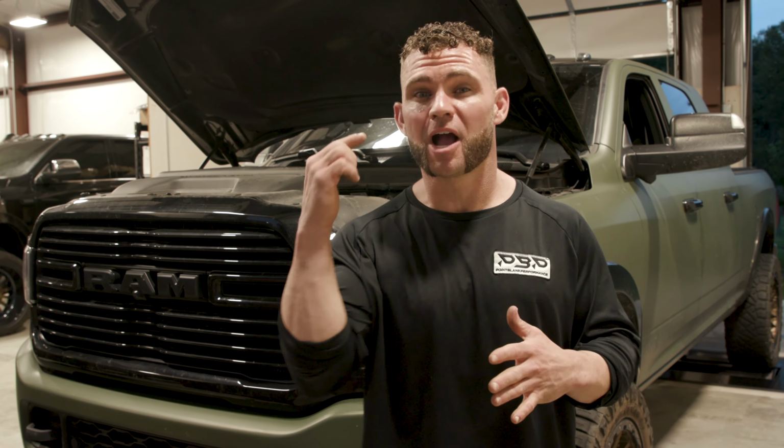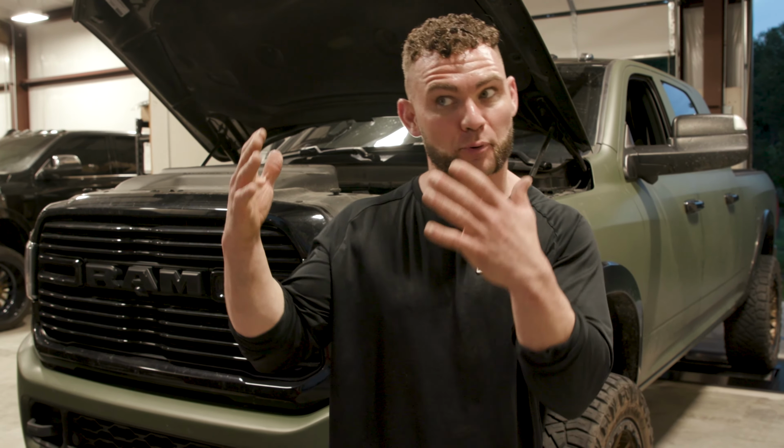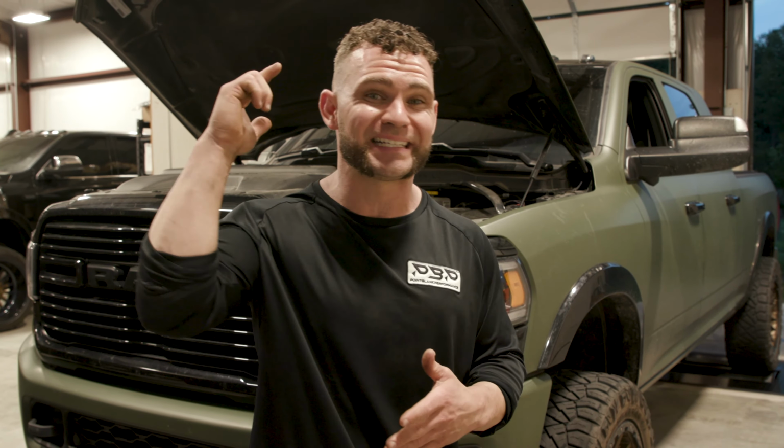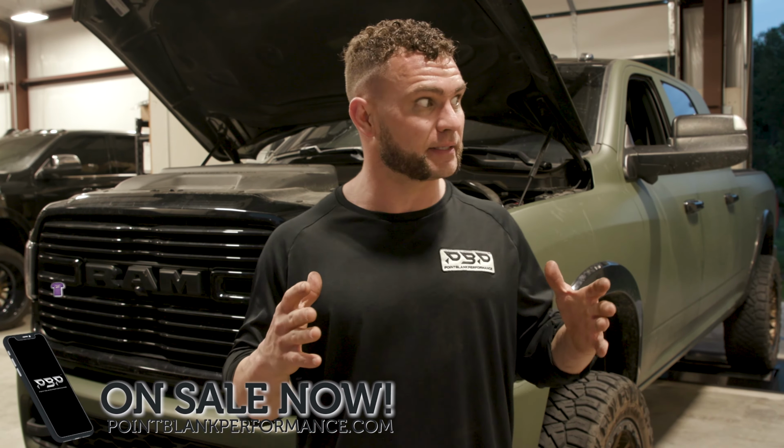Guys, I want to clear one thing up. What did it take for me to make 900 rear-wheel horsepower on that Mustang Dyno? My 12 model took an 80 millimeter turbocharger with 250% over injectors, just to hit 900. What did it take for me to get to 1,000? It took a pretty cool day, and it took an 88 millimeter turbocharger to get over that 1,000 HP. I wanted to clear that up, because that 1,000 horsepower is kind of a big, serious deal around here. And today, we're reinforcing that.